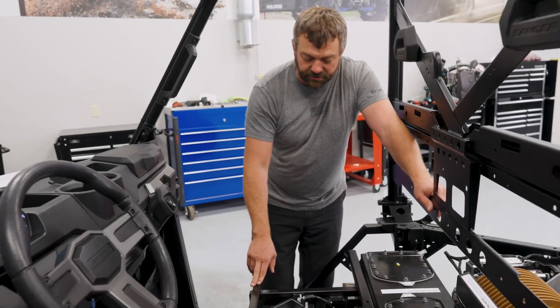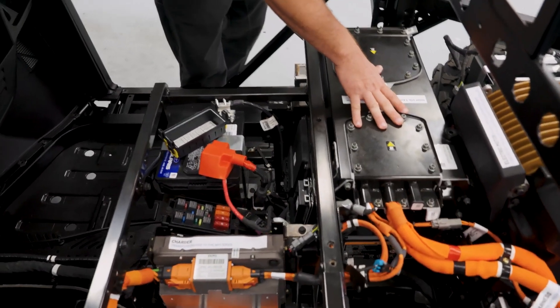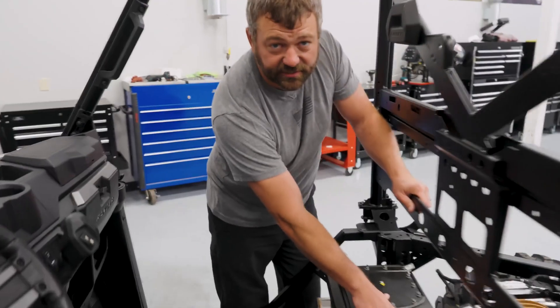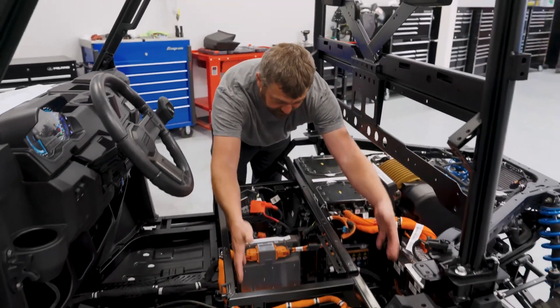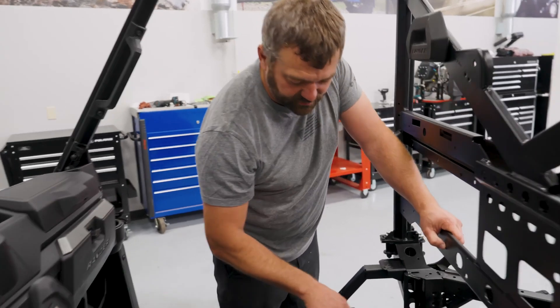That fan's kicking up to let you know it's working. This 100-volt battery pack here behind the passenger seat is kind of the heart of this Ranger XP Kinetic. This model is a single battery style setup. If we had the dual battery packs, there'd be another one right here underneath the driver's seat — that open void of space is where the second battery goes on the 29.8 kilowatt-hour version of this vehicle.